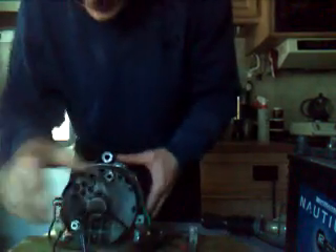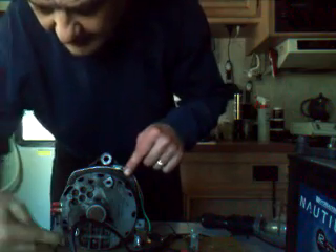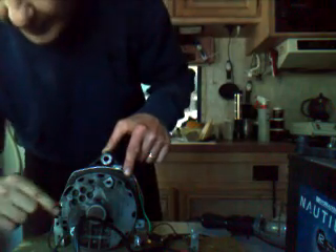So that's all you really want to remember: the negative is on the outside of the case, the positive is right there, and you've got to run power back into the field windings. I hope that's a little bit better picture for you there, Corey.